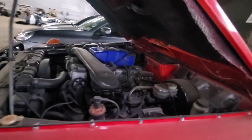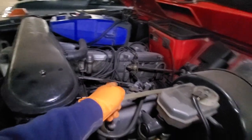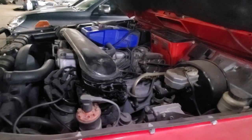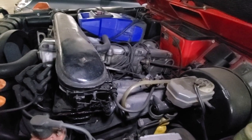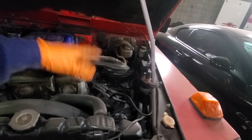It runs - a G-Wagon with a carburetor. Now that is the way you fix an old Mercedes-Benz with a fuel distributor. It used to have the mechanical injectors, but they've been capped off - all six of them have been capped off, and now we just have a carburetor on the original intake manifold. That's interesting if you think about it, because this intake manifold was never designed to have fuel going through it - it was only designed for an injected engine that would just have air going through it. I would venture to say this isn't the most efficient design, because the engineers were not thinking a carburetor would be slapped on that intake. But I could be totally wrong - maybe this is an intake that was meant for a carburetor on the older G-Wagons.